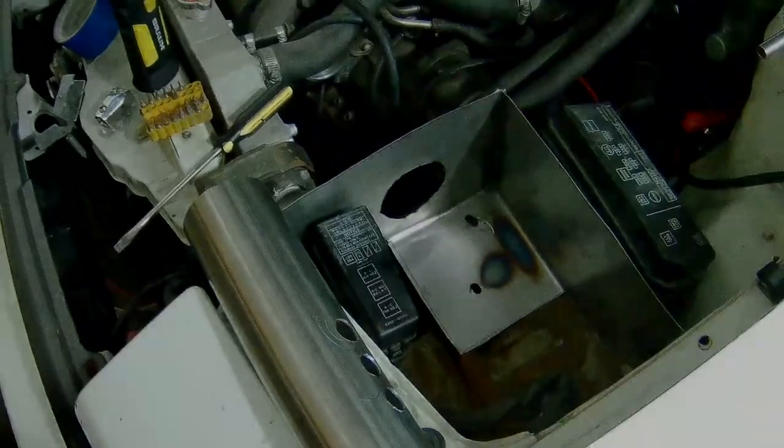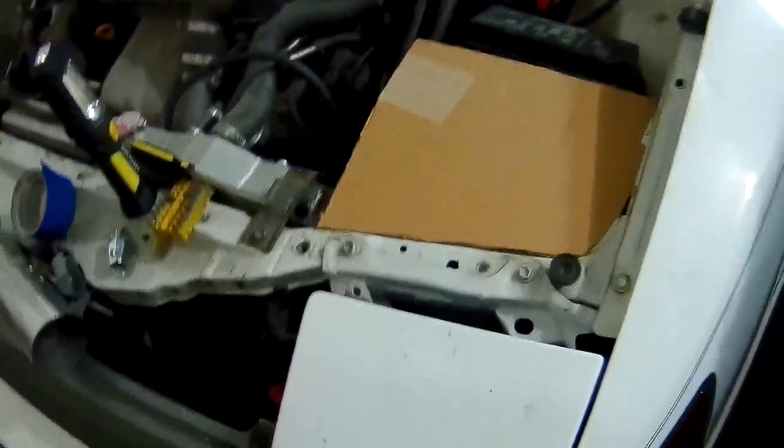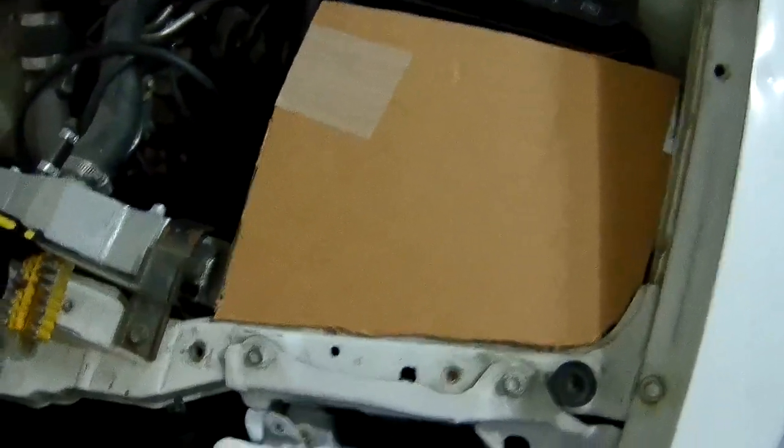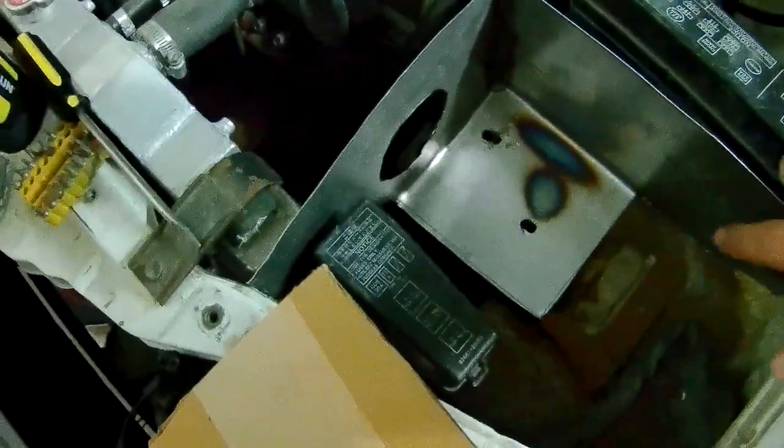So be right back. With a box cutter and an Amazon box, this is what I came up with. Fits pretty well around the edges. Probably a little bit of finagling there, but what I'm thinking I'm going to have to do also is around all these edges, take a vacuum hose, slit it down the middle, or find something else, and put a rubber piece around the edges on the box and on the cover. That way when I tighten it down, there's a little more of a seal. That's the idea. But now what I need to do is turn this into metal and still make the brackets.